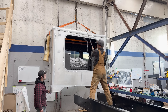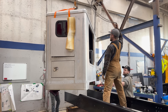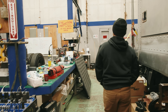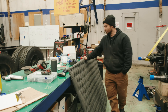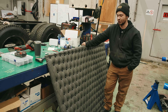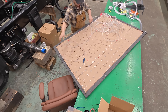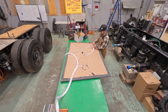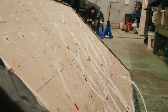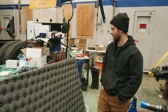When we picked up our sleeper, they did all the custom diamond stitching for our customer and gave us a bunch of extra materials so we can match the cab — and this is what it ended up looking like. Built it all from scratch, cut it out of an MDF 4x8 sheet, screwed all the buttons down, stitched all the leather, put the foam in, and then we ended up doing the Starlight Headliner. That's 400 fiber optic cables and lines, and it should look pretty good by the time it's all said and done.